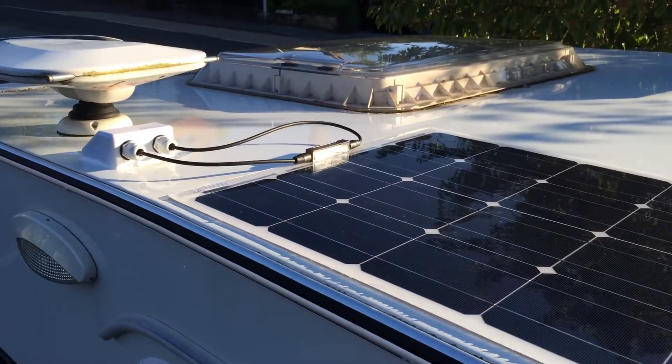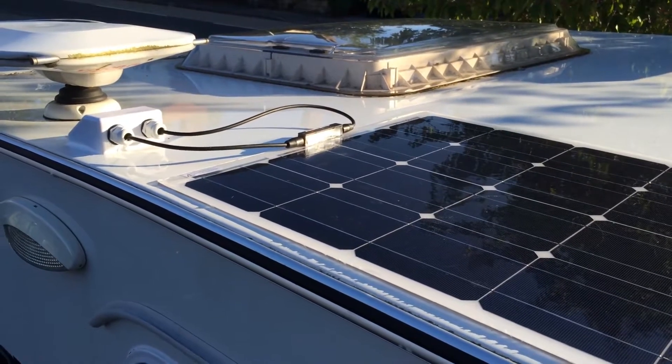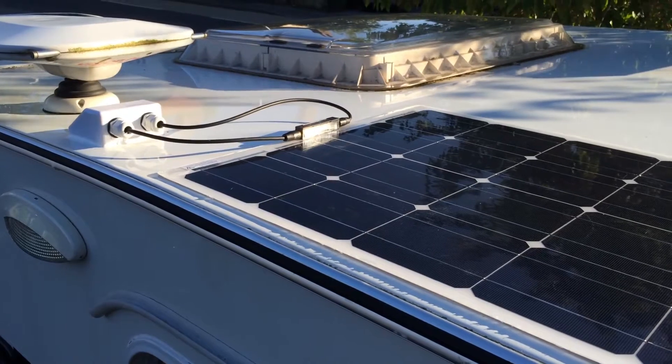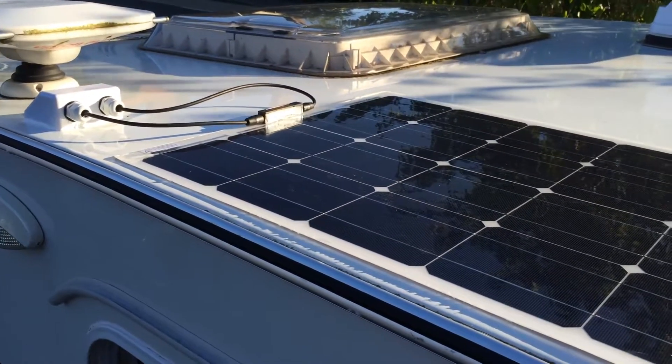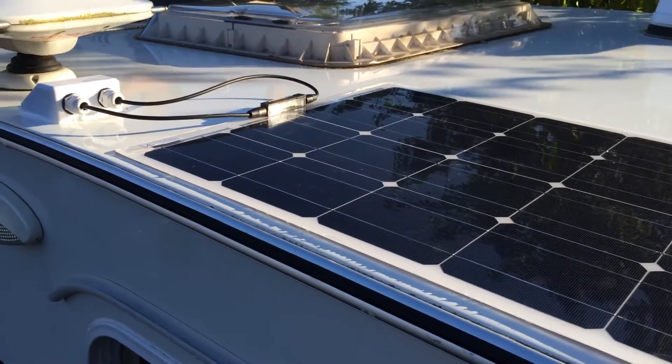This is my solution to the slight power drain problem which I've been experiencing over winter on this caravan. Basically the caravan is using a small amount of power to operate the alarm system even though everything else is turned off, so the alarm is drawing about 0.2 amps.